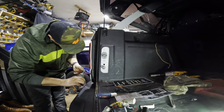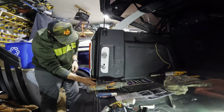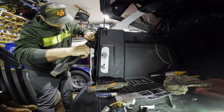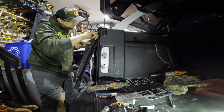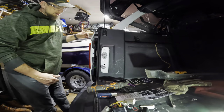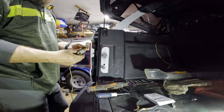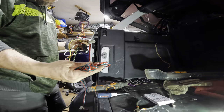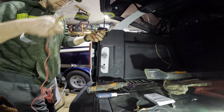There's a 10 millimeter screw on the taillight. This stuff is just like a rubber, maybe slightly plastic cladding to protect from getting gunk in there. It looks like this is the connection we are after. The driver side connector is yellow and the passenger side is the red and green. Let's try and get this disconnected and the harness connected.